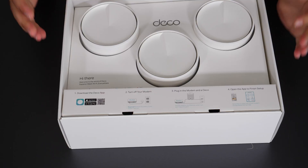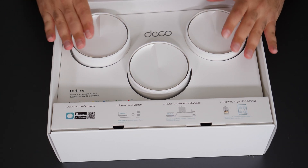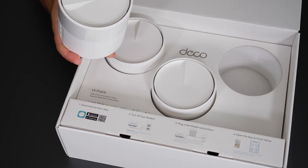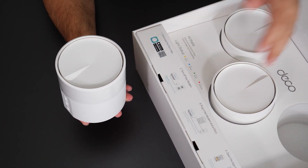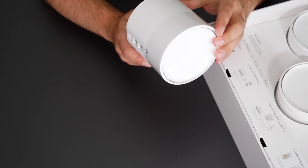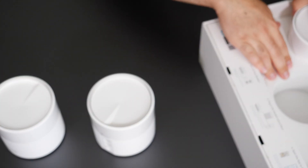Let's open this up and see what's inside. This is the Deco X20 — I've reviewed the Deco X60, X68, and X90, links in the description. Those are all basically higher models; this is pretty much the lowest of that family line. All three units appear to be routers, which is good, because you can connect just one if you want. You could buy a 3-pack and use them separately, since technically each one is a router. Each unit has two gigabit Ethernet ports, a power port, and a reset button on the bottom for factory reset.